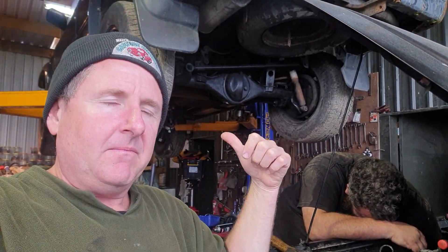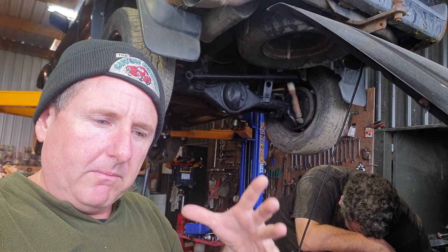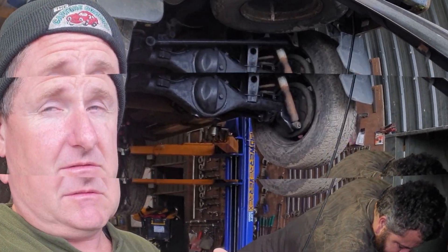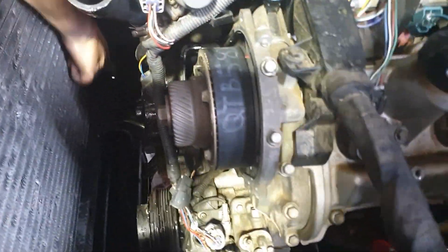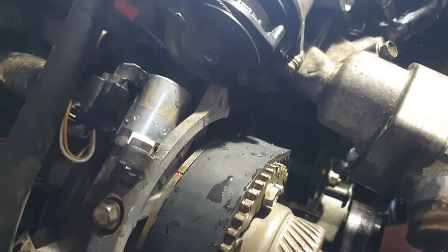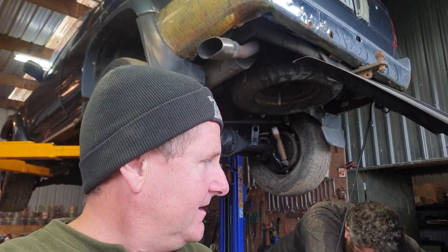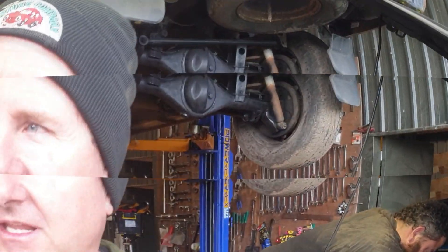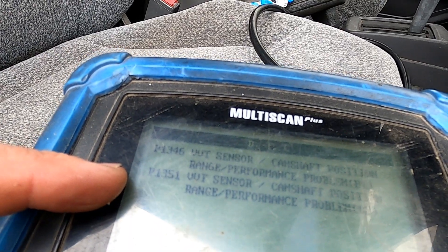Anyway, very quick one. We see this quite a lot — guys contact me telling me they've got VVT-I faults, problems in the VVT-I system. I ask them: has it just had a cam belt? Look, it's an aftermarket belt but that belt is new. We look down where the water pump is — it's new — and this one has a new VVT-I solenoid. But when we connected the scan tool it still had faults. On VVT-I systems, particularly the 3UZ, they come up with cam performance faults. We've got the check light, VVT-I camshaft sensor faults — both sides, both left and right.